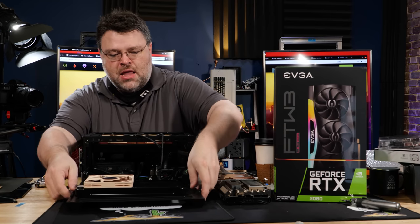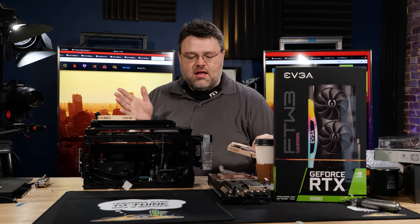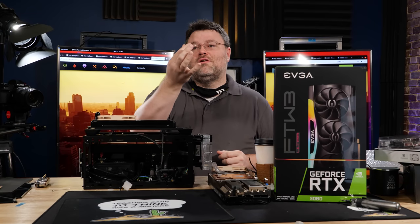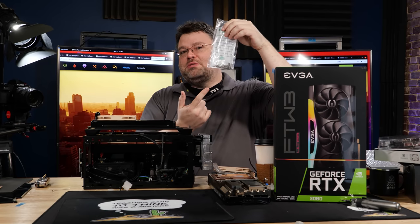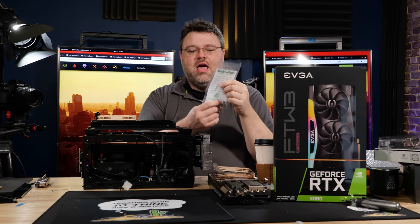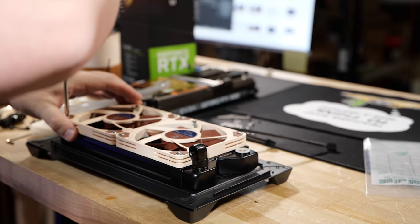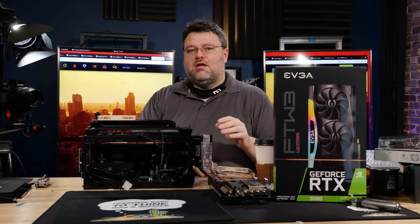I've got 45-degree and 90-degree angle connections. For the radiator, it's thinner even than the radiator vendor expected — thin radiators never come with appropriately short screws, assuming you'll also use thin fans. The screws it came with are number 6-32 thread and over an inch long. I had to go to the hardware store and get a mix of three-quarter inch and one-inch screws. If you use screws that are too long you will pierce the radiator, so be careful — or use washers to prevent the screw from going in too far.